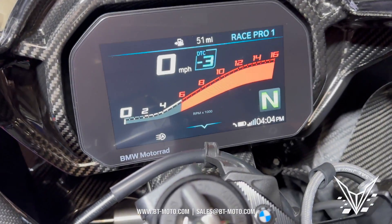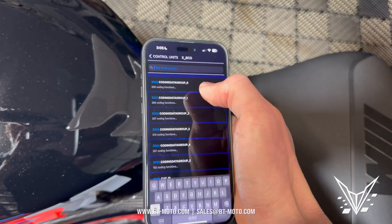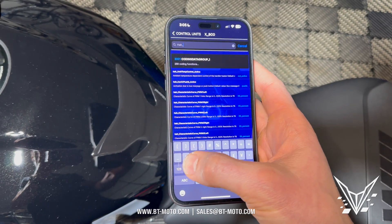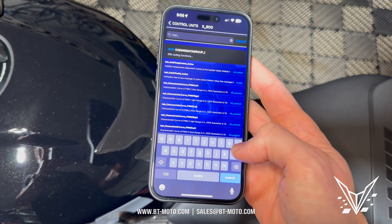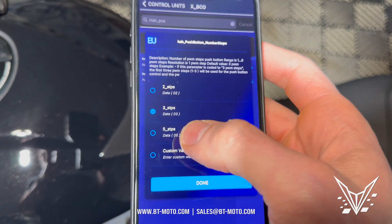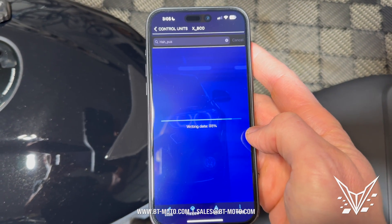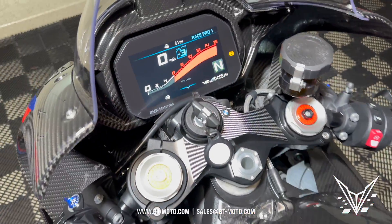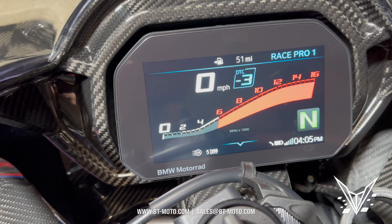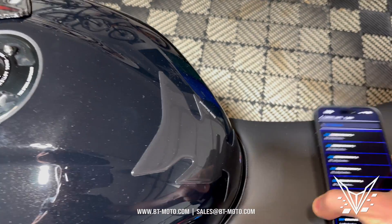You can see right here it should be back to three — yep, only three. So I'm going to go ahead and put this back to five now. HA H-A-H — HA right there, push button number steps, and we're at three. I'm going to go back to five again. Done, and we're going to go ahead and code it. Now everything should be back again — push button right here for the heated grips, five steps again. So that takes care of the heated grips. That works on all the 2020 through 2023 models.